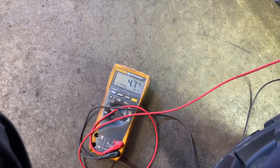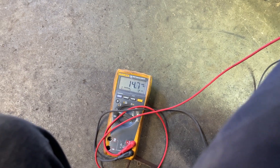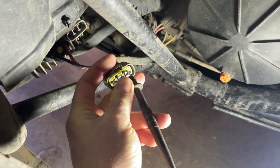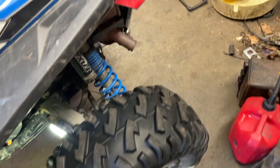Take your first two leads — you can see right there we're awfully low between one and two, way low, and between one and three as well. So we likely have a bad stator.